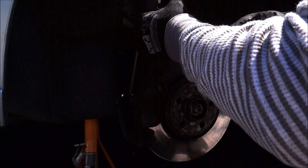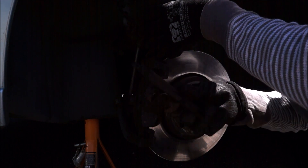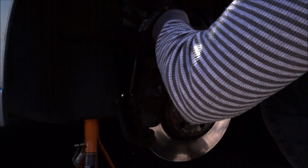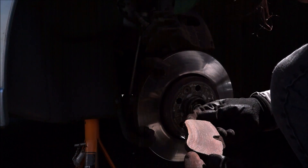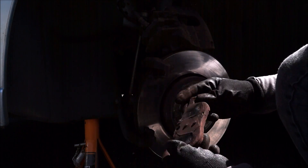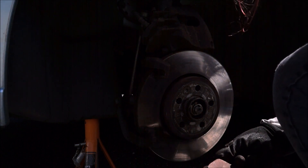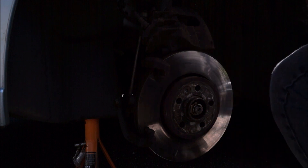One is actually physically mounted into the piston via a big metal clip. There is quite a bit of meat on there but it doesn't look very nice at all. I'm going to rest that on top of the disc. That's come out quite easily but yeah, they're looking quite crusty and quite damaged around the edges. Yeah, I'm going to change these. I'm still doubting whether I need to change these discs because they look fine - there's no scoring, just a small lip on the very edge. I don't really see the point in replacing both.